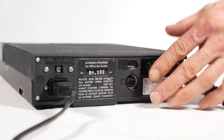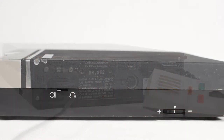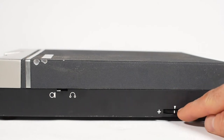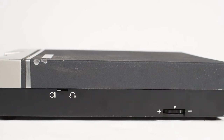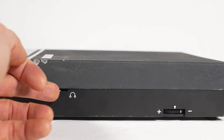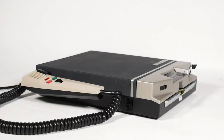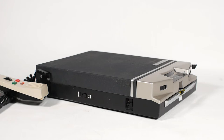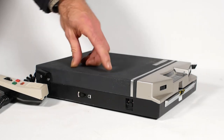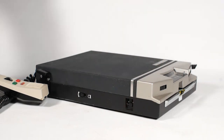And finally the socket for the microphone, which also has the recording and playback controls. On the right-hand side towards the rear is a knob to adjust the playback speed, faster or slower. And towards the front is a switch that appears to allow the head to move closer to the outside of the disc when set in the playback position, to ensure that you hear the start of the dictation. On the left-hand side is a cradle to hold the microphone. Then there's a switch to select whether the incoming audio is recorded from the telephone or the microphone. And finally this lever, which lowers a magnet against the disc to completely erase it.